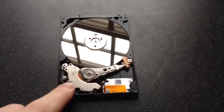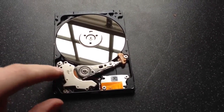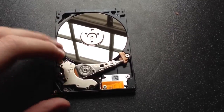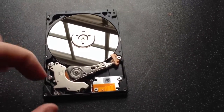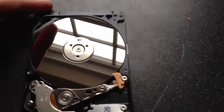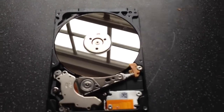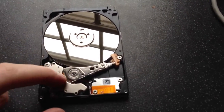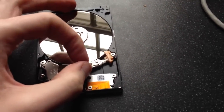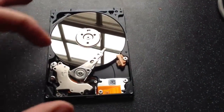The read arm is actually controlled by essentially two powerful magnets and an electrical coil in here. The coil uses the motor effect — power goes through the coil, you can probably just see the copper traces, the copper wires. Electricity goes through that and causes the motor effect between the magnets, which moves the head to a certain position on the disc.